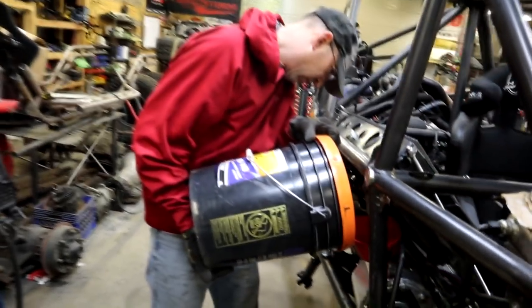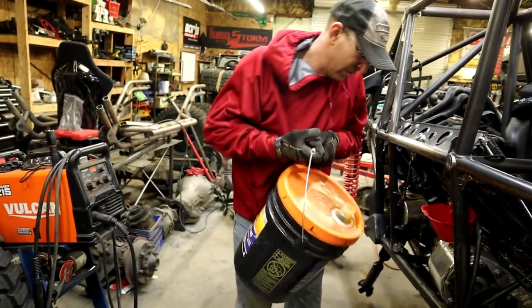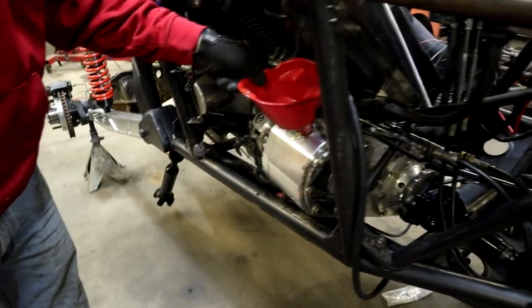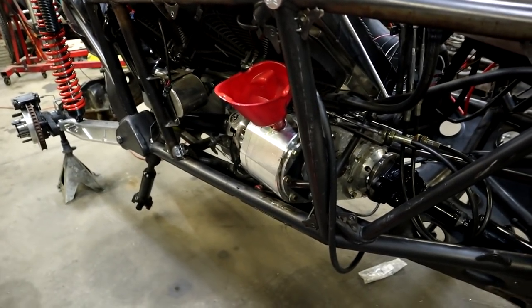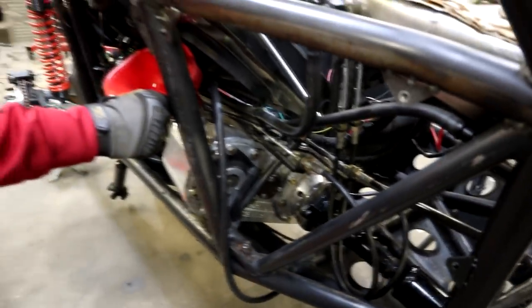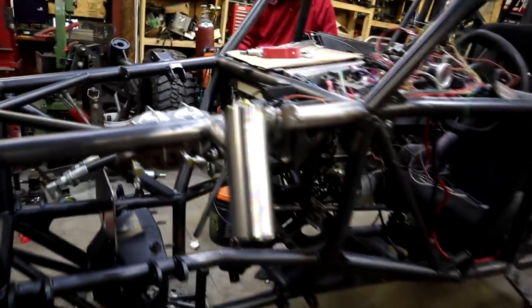Joe's over here filling the t-case, finally using 85w140 — we have a lot of that. About four quarts right now, six quarts somewhere around there — we have to overfill it a little. We moved the vent to the top of it versus the normal spot because it's clocked up a little bit, clocked opposite of what it probably would normally be. We also got the right yoke for the drive shaft, so that's taken care of. We're waiting on a couple brake lines — they'll be here in a day and then we'll have the entire brake system plumbed.